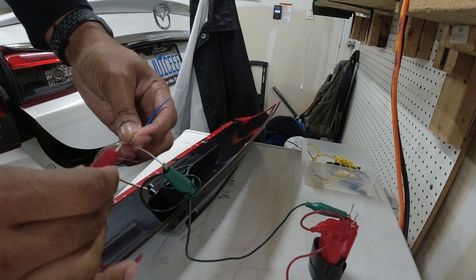Okay, so it lights up. Yellow is going to be the parking light, so when your lights are on it will light up constant. That should mean that blue is going to be the brake light. Let's simulate driving down the road — hit the brakes and this is going to do a continuous flash while your foot is on the brakes, then you let off the brakes and it goes back to the constant running light.